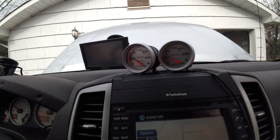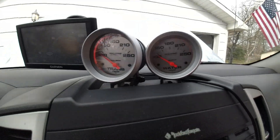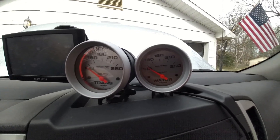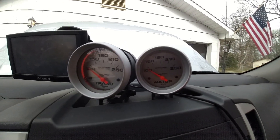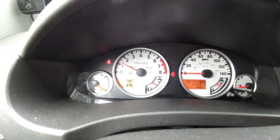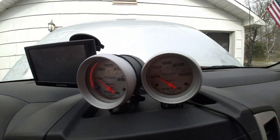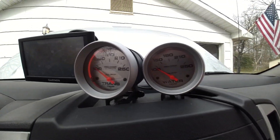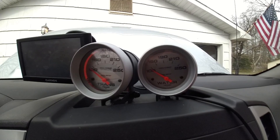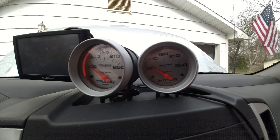Moving on over to here, we have my gauge package, which I added — engine coolant temperature and transmission temperature. I find these to be not only helpful but what I would call critical. Knowing what the true engine temperature and the true transmission temperature is extremely important. The gauge here in the cluster is not really a gauge. It's actually more like what I call an idiot pointer. It only has three positions: cold, operational, and what I call 'you just blew your engine.' It does not indicate actual fluctuations in engine temperature. When it reaches a certain point, the needle just jumps up and stays there.